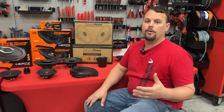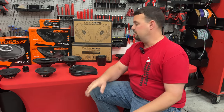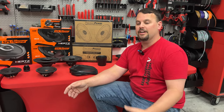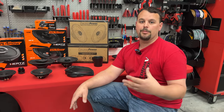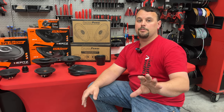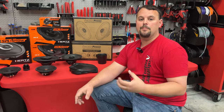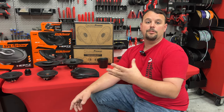If you're using a factory radio, we're always going to flash that radio, and it does four things at once. We're going to fix the terrible EQ that's in it from the factory — it has a bass boost that none of these speakers want to play without distorting. We're also going to make it so the EQ doesn't change while we're riding down the road. We're going to attenuate the radio down to where it's a good usable input for our amplifier. And we're going to turn on the rear channel, so if you don't already have a Limited or Ultra model with rear speakers from the factory, those rear channels get turned on. With the exception of the Hogtune/Kenwood systems — which don't require a flash — all other systems need to be flashed for a better, cleaner input signal.